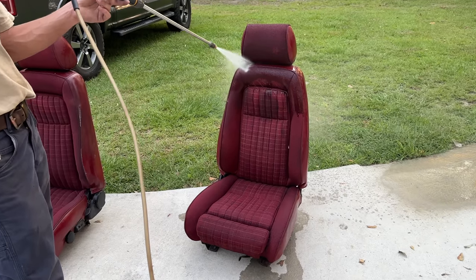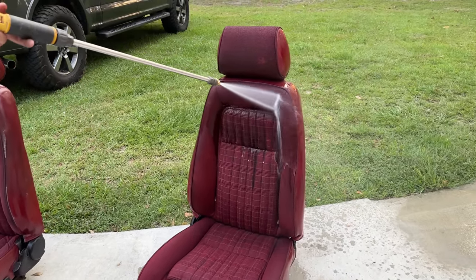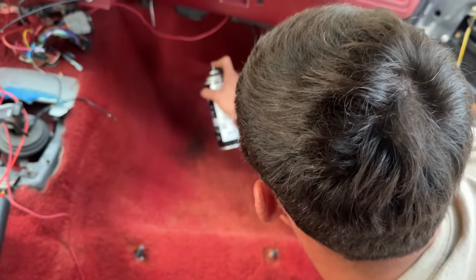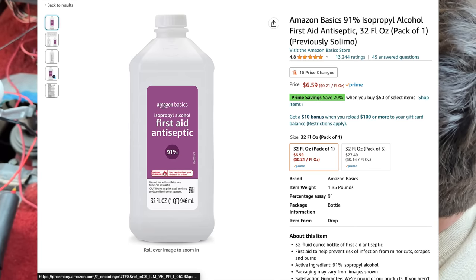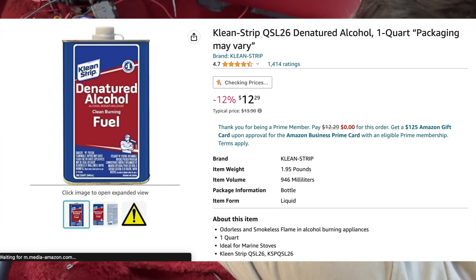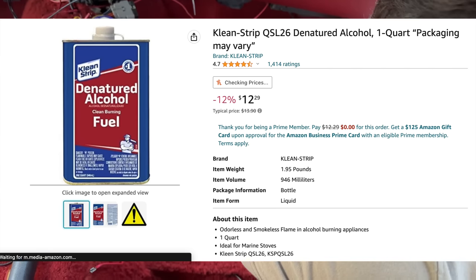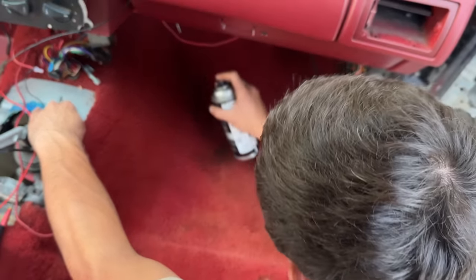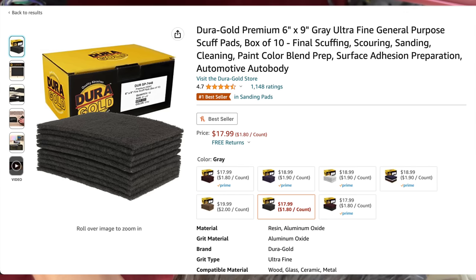Since Andrew is refreshing his interior, I thought this would be a good time to revisit how we go about prepping and spraying and what we use to do it. First off, you're going to want to wipe everything down with either isopropyl or denatured alcohol. That's going to clean everything, keep you from getting fish eyes, and also dry the part out to the point where it'll accept the dye. We also use a gray scotch pad to lightly scuff everything up and give it a little bit of tooth so that the dye bites in.